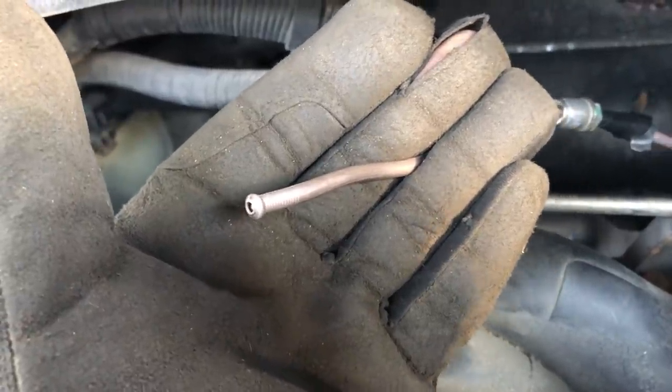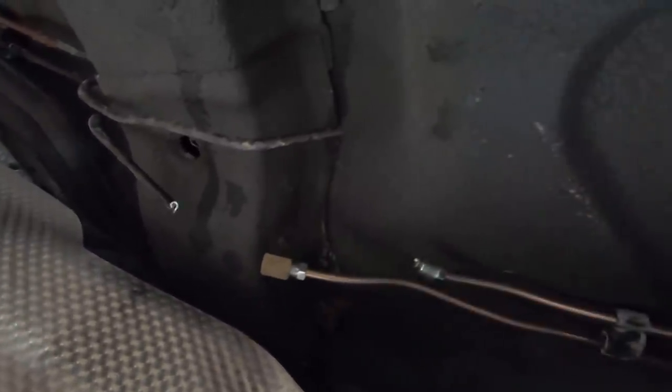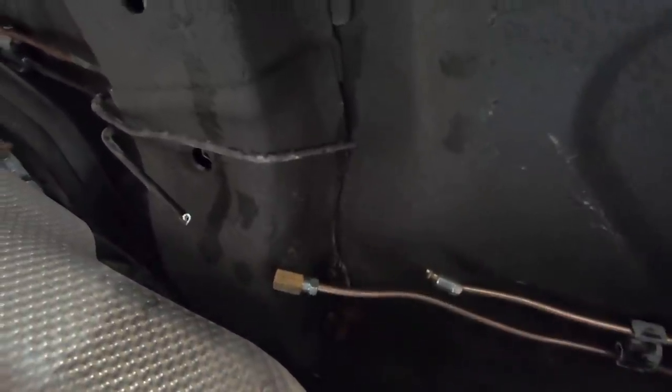It looks pretty good. All right, it is the next day, and I managed to get the front halves of these brake lines installed. I ended up going with an SAE inverted double flare for these, since because this is America, that's the more common flare, and it's easier to find things like unions for these. So we can just thread a union on like this, and then when I make the back halves, I can just screw them into this, tighten them up, and should be good as new.